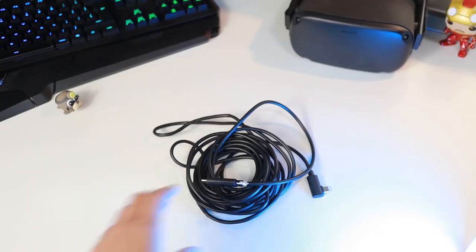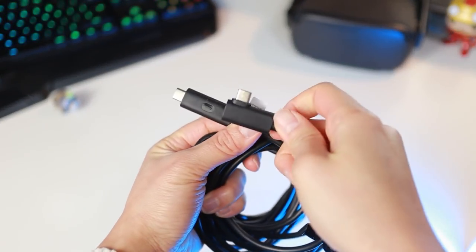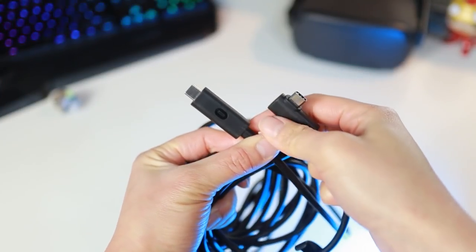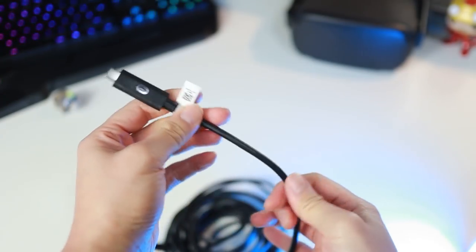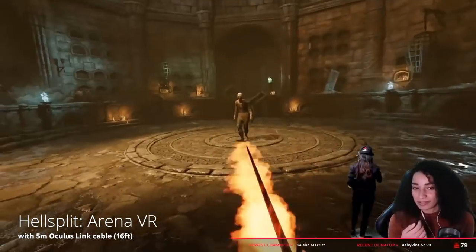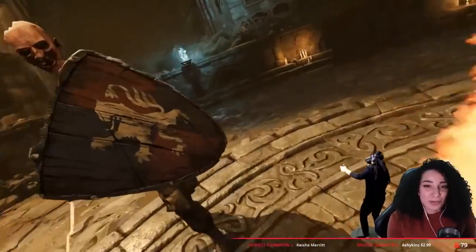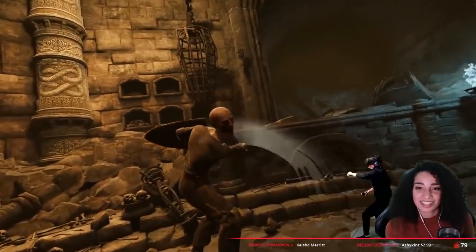But does it work well? Let's talk about the differences. The Oculus Link cable is made of optical fiber, while the PartyLink cables are made of active copper. Optical fiber has benefits over copper. First, it allows for a more flexible cable — you can feel that the Oculus cable is a lot more flexible, while the PartyLink cables are more rigid. Optical fiber is also able to give higher speeds and better performance over long distances without sacrificing compatibility. So yes, the Oculus cable has newer technology, and that is also why it is so much more expensive.